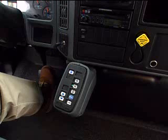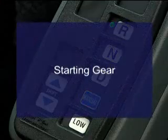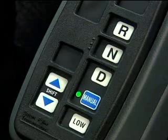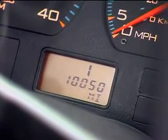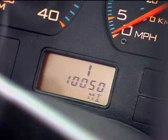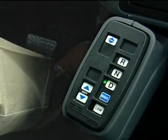Assuming you've achieved normal power-up — a solid N on the gear display — start the engine. The process of selecting a starting gear is the same whether you select reverse, drive, manual, or low mode. First, apply your service brakes and select a mode, then release the vehicle parking brakes. The gear display will flash the gear you're going to; once the gear is engaged it will stop flashing and become a solid display. If you selected drive or manual, the Ultra Shift HV will only allow you to start in first gear.